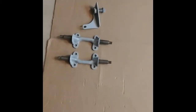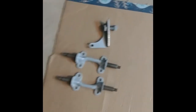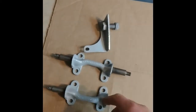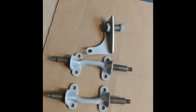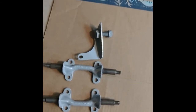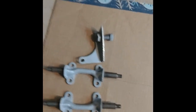I'm continuing my powder coating. I have just 3 parts that are completely done. It's hard to get the powder into some of the acute angles here, so I'm going back and hot flocking to get the powder into the crevices. And so a lot of the parts I've done, I have to go back and heat up again, powder coat them, heat them one more time, and then finally I have them done.